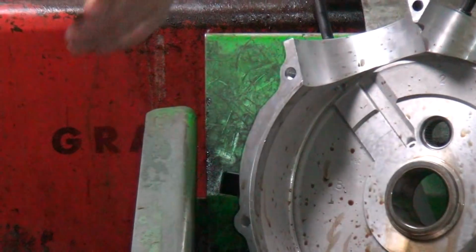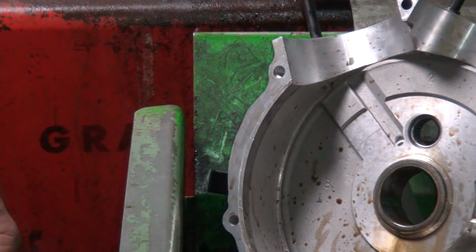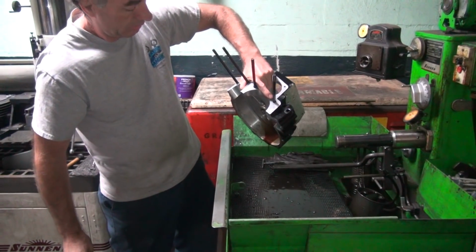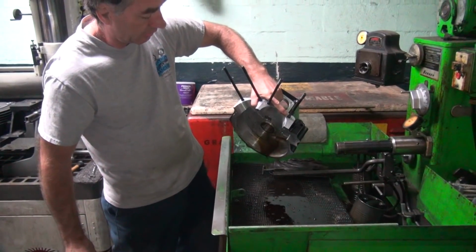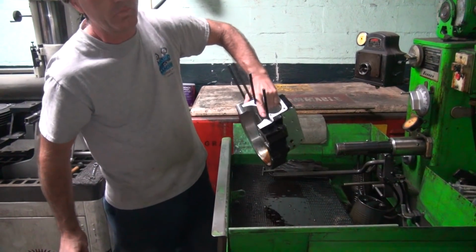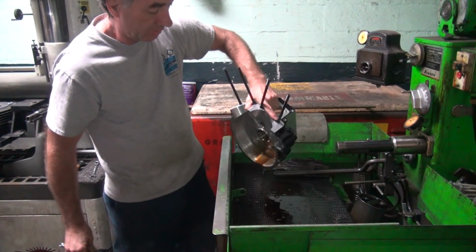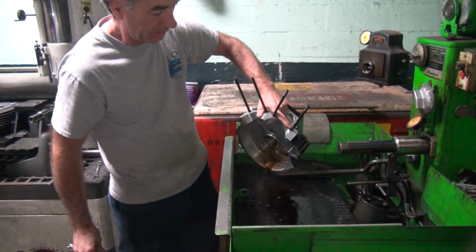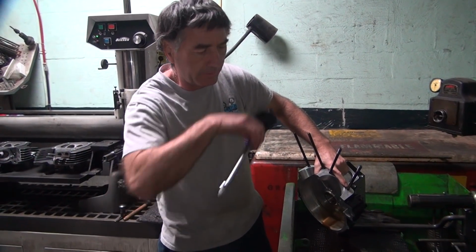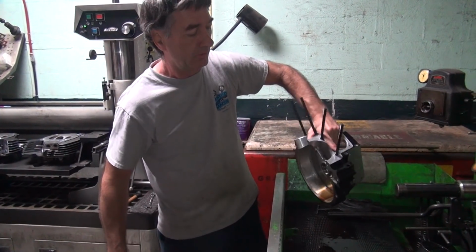Looks like we're 19 to 2.5 now. 20 now. Okay, so we opened up about 3/10. I think we have a tick rounder. Still not perfect. Rounder's more better. I just took out a couple tenths more. I took out 2 to 3, depending on what you're measuring. I think the tightest spot we have is like 16.5, 16 maybe. Now we're up to about 19. There's our loose spot, so we'll pick up just a little bit.